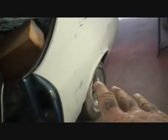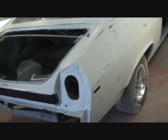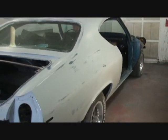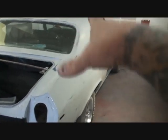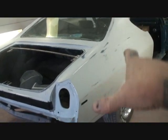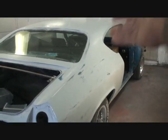Here's an area right here. We got this little area right here going across, and just basically getting those small areas that we need to make sure that this thing is surely primed and block sanded perfect. That is the very crucial situation I have here. I don't know how many times I'm going to tell you this, but your prep job is your paint job, plain and simple. So let's not skim it and just blow some paint on it, because we've already primed it twice.